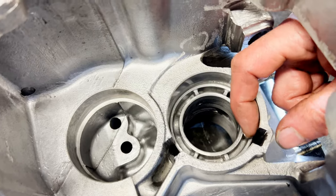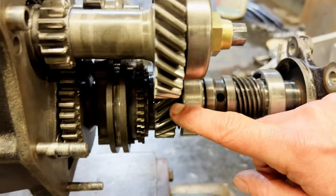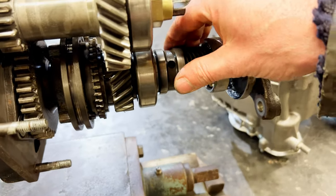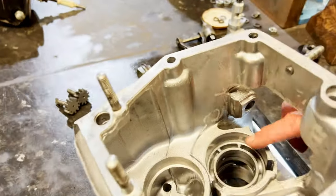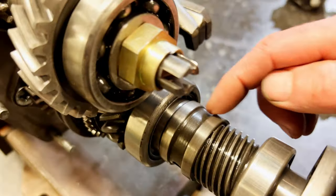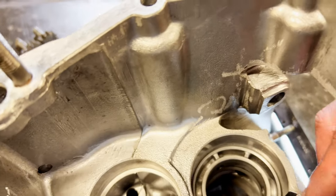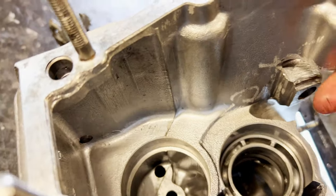So the oil comes up to here to this area, then it goes around all of that. In here is all going to be pressure from the oil pump, and then it's going to squeeze through the bearing, come out through here and come out through there. So that oil there is going to get shot out through here onto your fifth gear drive - which is what they say it's for, oiling your fifth gear. It'll shoot out onto there, and this bit is sitting in the middle, so it's going to force it into there and over the top and through that piece, and it's going to splash everywhere over everything.